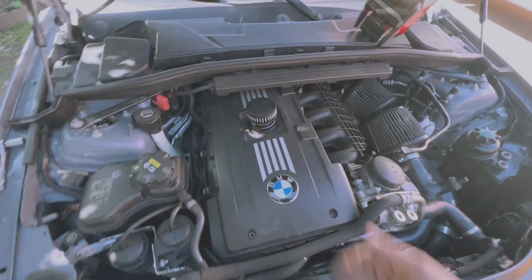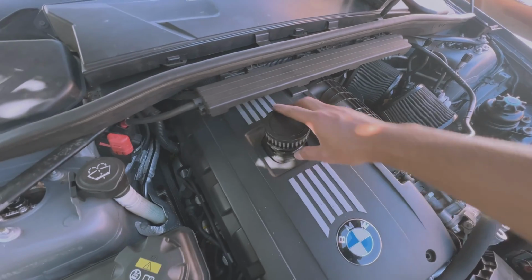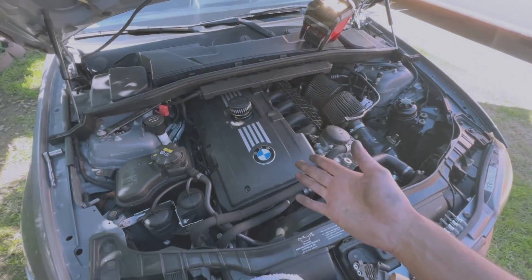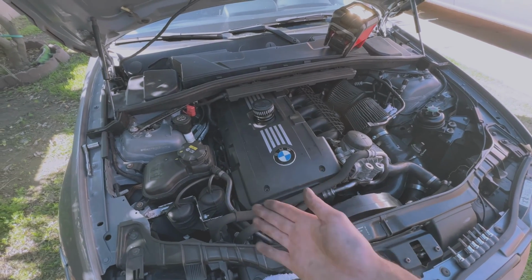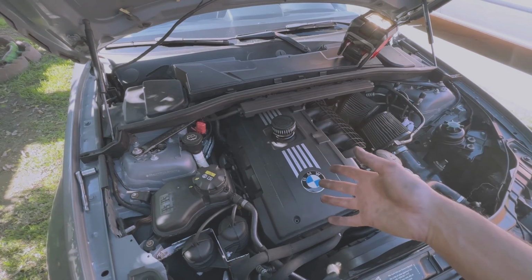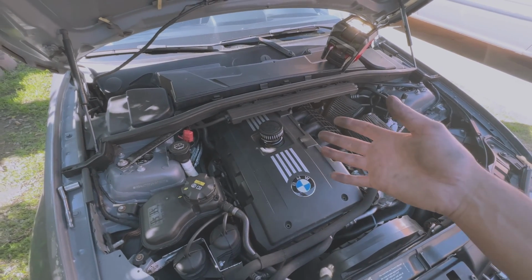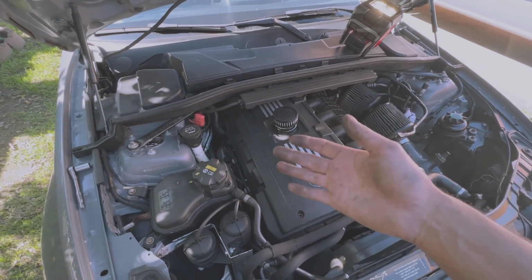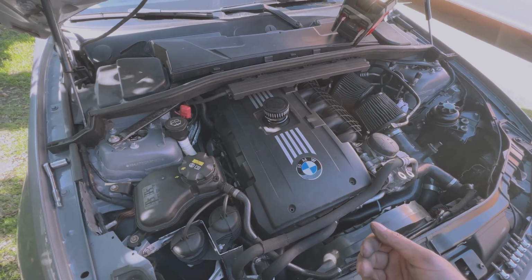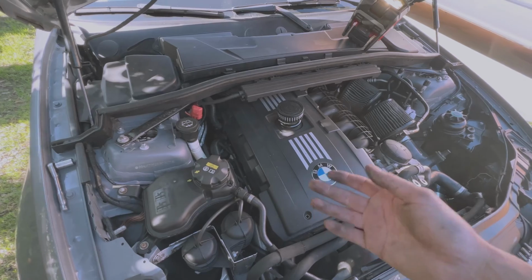And yeah, I'm not sponsored by any of these people or whatever, but from what I know, this is going to help out your N54 a lot more, even when it comes to draining your oil, because turbos need to be able to drain the oil. And if your crankcase pressure is too high, your turbos are not going to be able to drain the oil because of all the pressure in the oil system. But yeah, just thought you guys would take that into consideration.